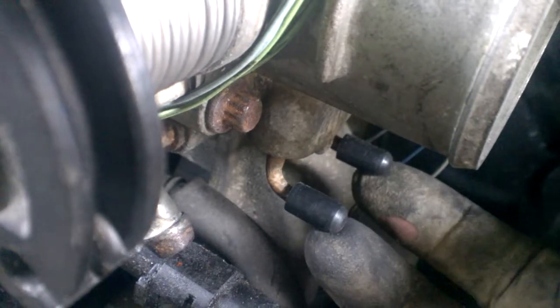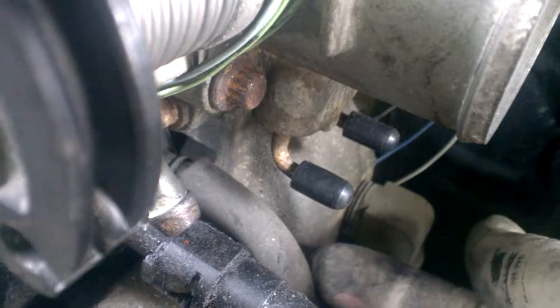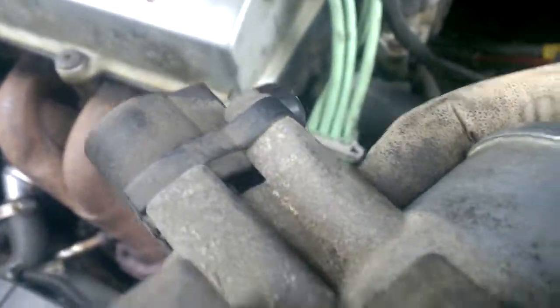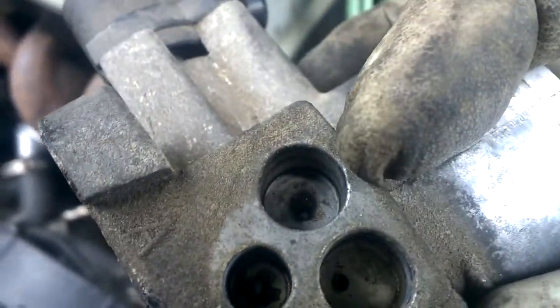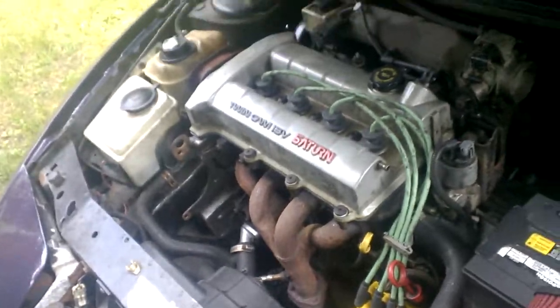Under here you'll see I have the EVAP and the EGR from the old throttle body plugged off. I am doing a test. The purge solenoid is back under the intake manifold where you can't see it. It will need to be routed into one of these ports, as it is a ported vacuum signal indicated by one of these upper two holes. One of these was for the EGR on '91 to '94 Saturns. '95 and up uses only one of these two for the EVAP system. The EVAP system only engages during cruise speeds — it is not engaged during idle and it is not engaged during acceleration.